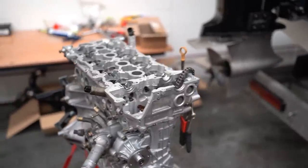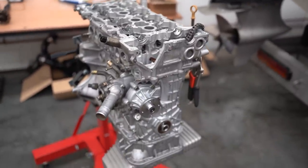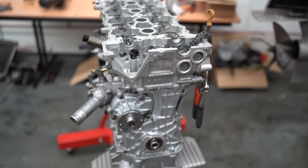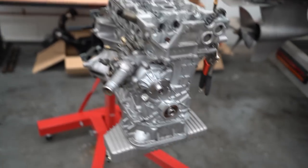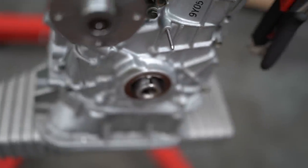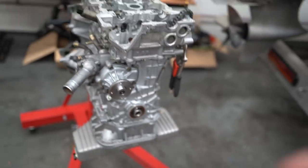Sorry if the timeline is a little bit confusing — it's the next day. I can't get anyone to pull the bolt out until tomorrow and I'll need a new bolt anyway. So for now, because the cams is something you can do with the engine in the car, I'm going to start doing the intake manifold and the exhaust manifold and get everything else together. I also don't have the little half-moon Woodruff key bit for the crank pulley so I'm going to have to get one of those tomorrow as well. Engine should be done by tomorrow.